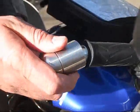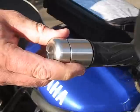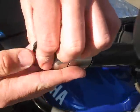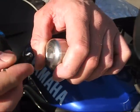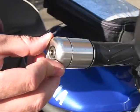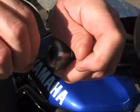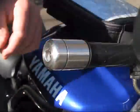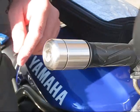So here's the shim — dump it in. That's about the way I like. Now I'll take the shorter screw and the lock washer. It just so happens that this particular screw-in style never has that red ring around the head of the screw like you see in pictures of some of the other ones — it's just plain. So you get out your Allen wrench and you screw it right into the end of that nose. That ought to be enough. There is a torque spec in the manual if you want to get fussy about it. It's good to play it safe — if you haven't done a lot of wrenching, it's good to follow that torque spec.